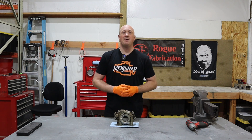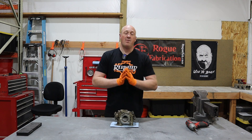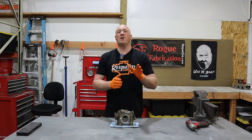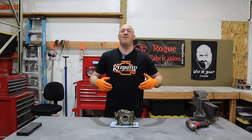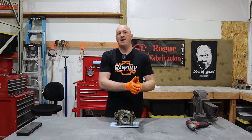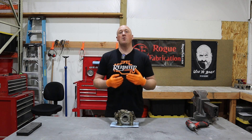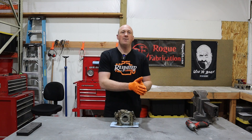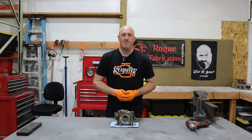Let's talk about the science behind why that is the case. On most of the vehicles that I see with cam and lifter issues, by far the vast majority are coming from fleet vehicles that have extended idle time, or if you're sitting in traffic a lot. In those situations when you're at idle, your oil pressure is the lowest it's going to be. Therefore, if we can improve that oil pressure at idle, hopefully we can prevent this lifter roller failure from happening.